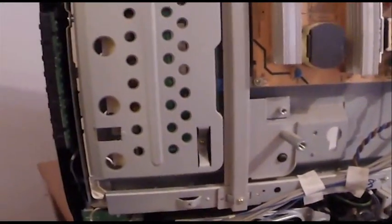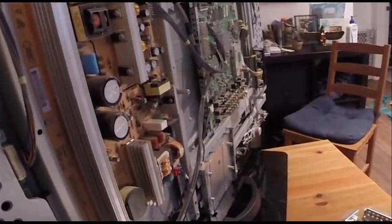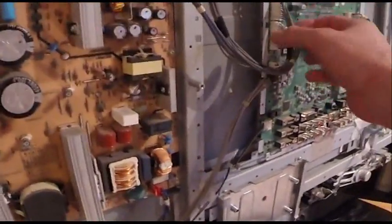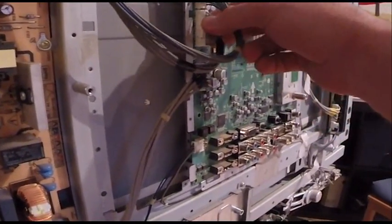And also, what would happen was, when it would power off, and let's say that light is just flashing, right? I pull power, it takes a couple seconds, and you hear a click. Plug it back in, and it would immediately turn on. It would resume and still try and power up. You couldn't get it to reset itself. That was the other thing that was going on. But yeah, it was just that wire had a bad contact with that pin.